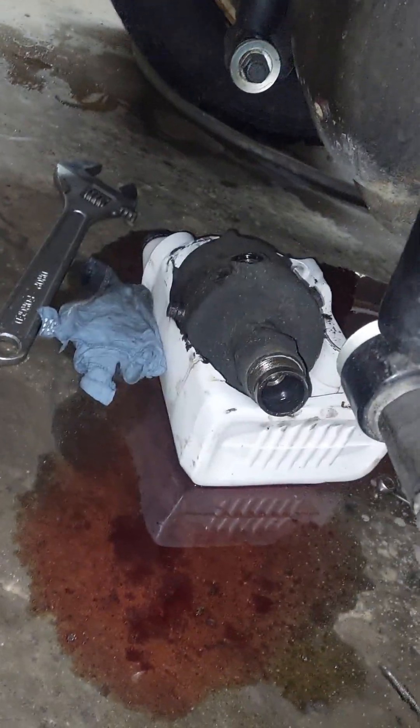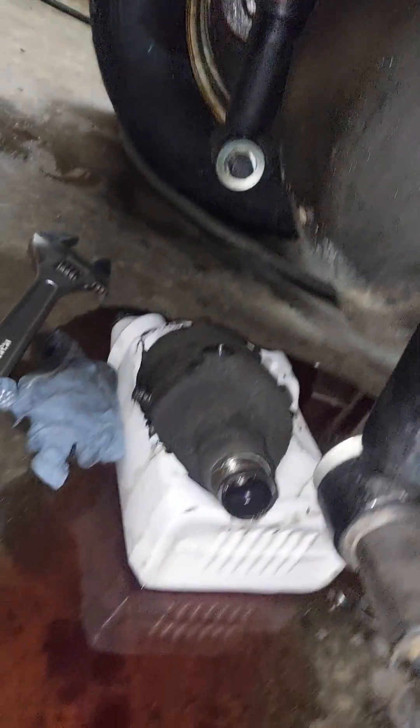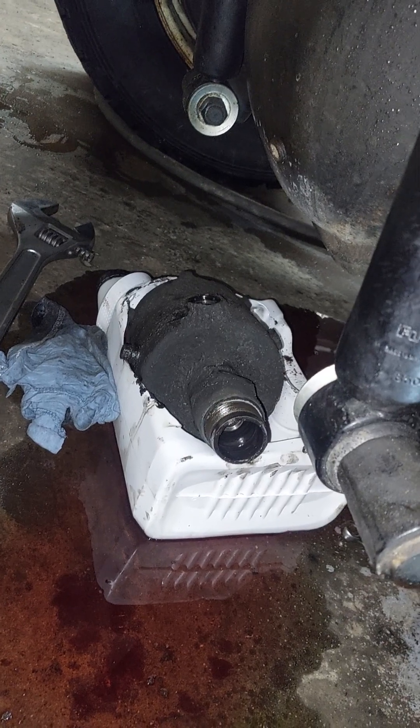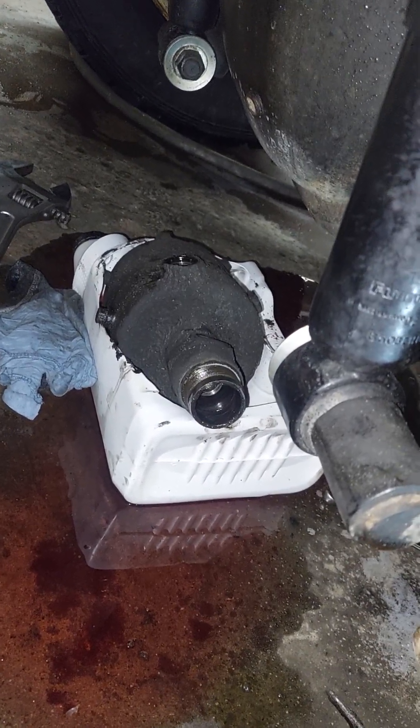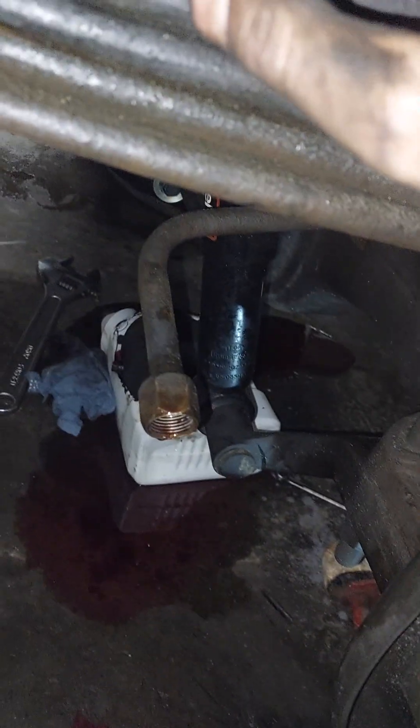On the back side here I've already got the maxi pot off. There's a bolt on the back of the maxi pot and you cage the maxi pot — the caging bolt is already built in. You cage it just like you cage an air brake pot. It pretty much works like an air brake.